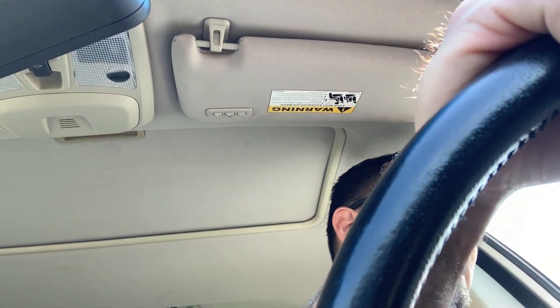For the brake bleeding, I did have to grab a second person to pump the brakes as I let the air out. I broke the bleeder valve, so that's not on video. I'm test driving the XC90 after installing the Brembo brakes. I'd say there's less initial bite, but I only have two miles on the brakes — the front brakes came painted and I have to wear that off, plus they're brand new pads. The rear brake lines seem tight with the car up in the air, so I may look for longer brake lines to give a little more slack.